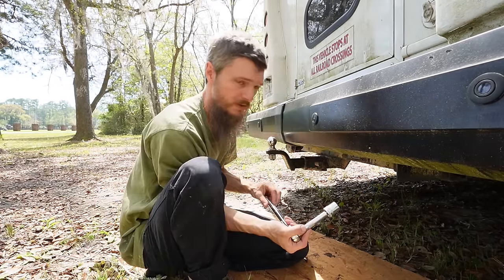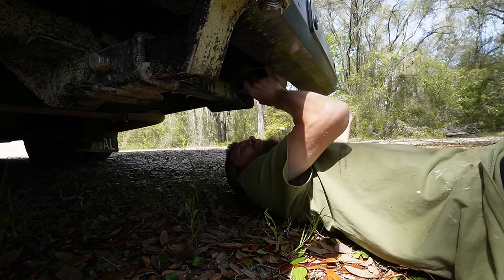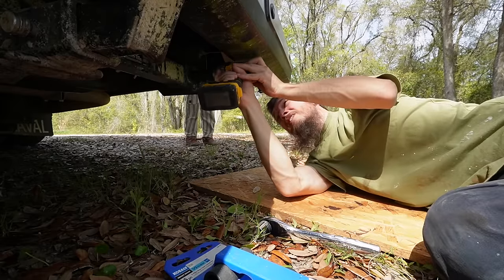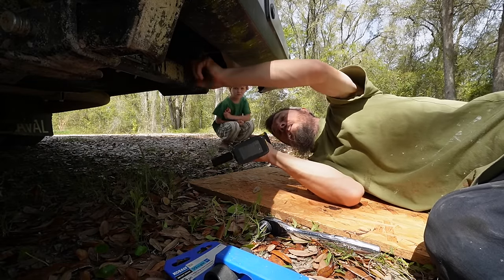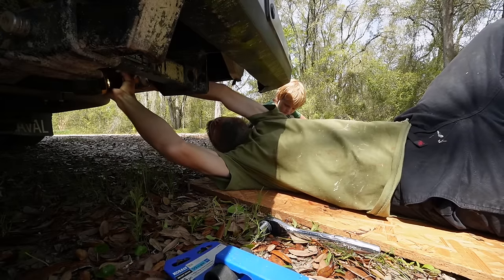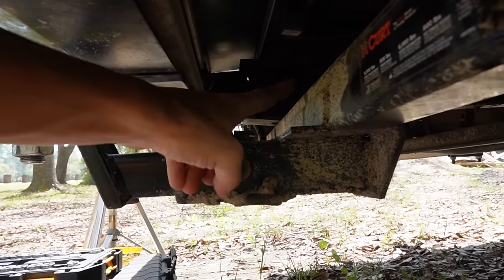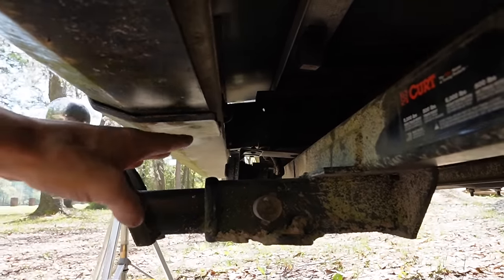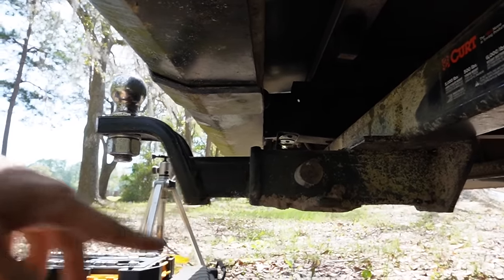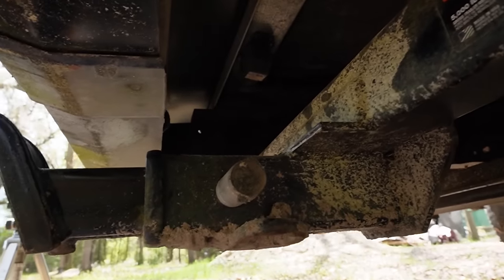I put these bolts on tight. I can't do it by hand, let me get the impact wrench. Got it! I'm trying to show you guys, before we take this off, the way this hitch is built — you see how it comes off the bottom here, it leaves quite a bit of room but makes it hang a lot lower than it needs to. Also notice how short it is, so the ball barely clears our bumper and it's hard to get a trailer on here. That's what we're starting with.